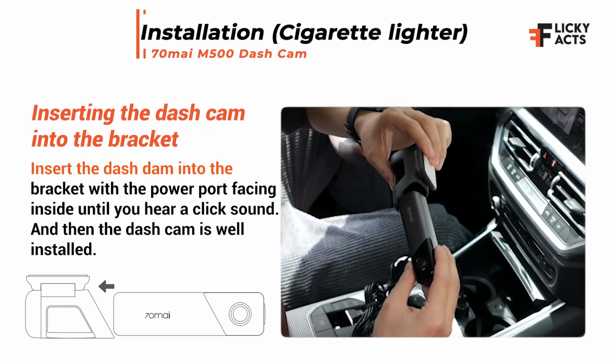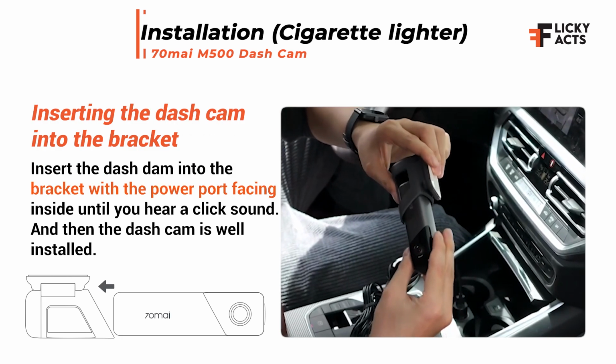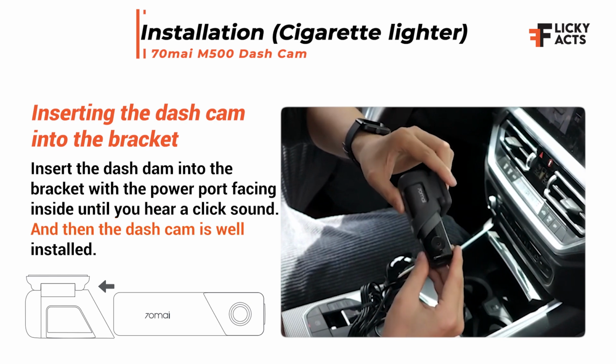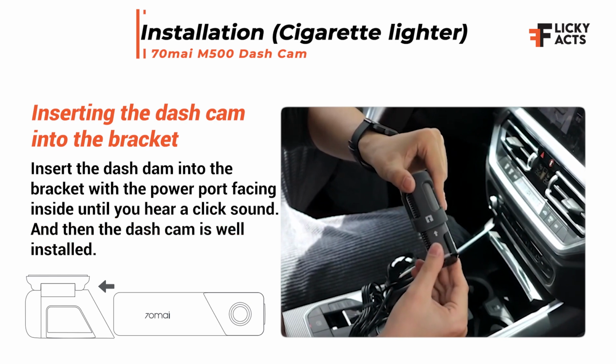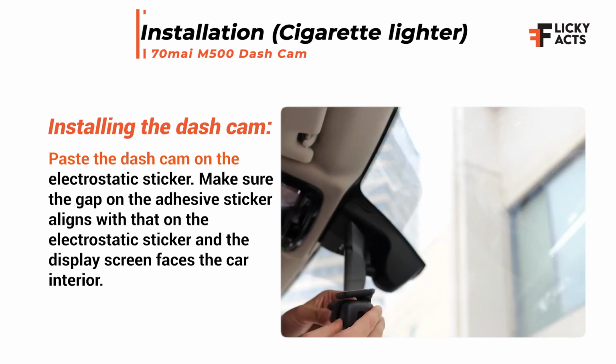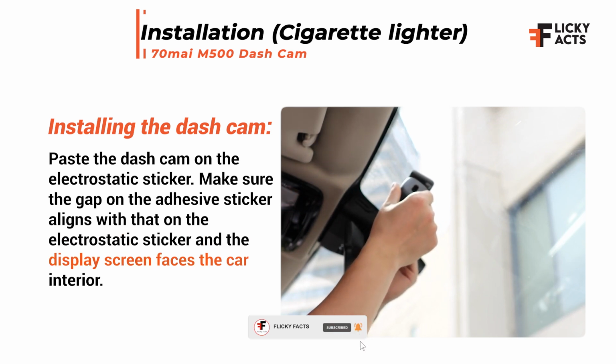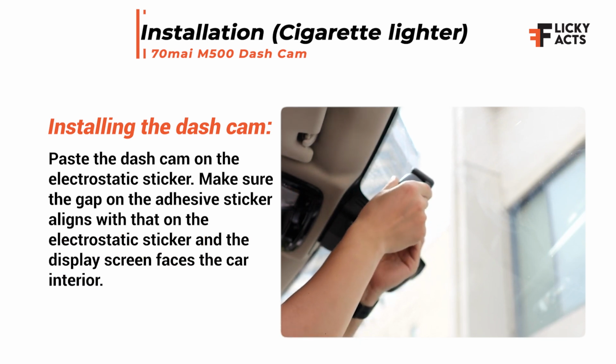Insert the dash cam into the bracket with the power port facing inside until you hear a click sound, and then the dash cam is well installed. Paste the dash cam on the electrostatic sticker. Make sure the gap on the adhesive sticker aligns with that on the electrostatic sticker, and the display screen faces the car interior.